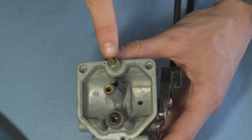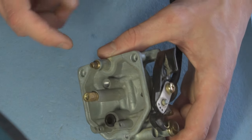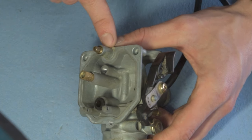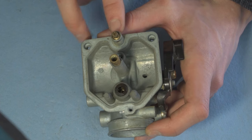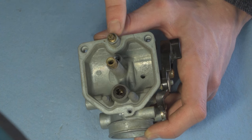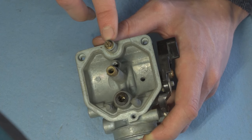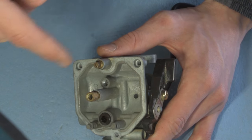The fuel screw is located on the bottom of the carburetor. On the Apollo RFZ it may look slightly different as some have an extended fuel screw that sticks out, while stock is countersunk. This is an air-fuel mixture screw controlling how much air mixes with the fuel. Tightening the screw weakens the mixture and decreases fuel flow — this is called making it leaner. If you need to lean your bike, screw it in. If you need to richen your bike, screw it out.